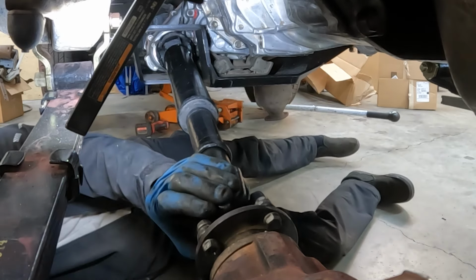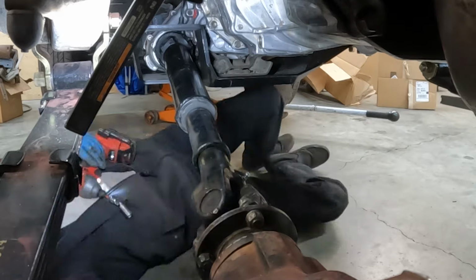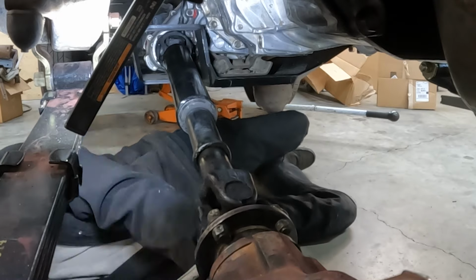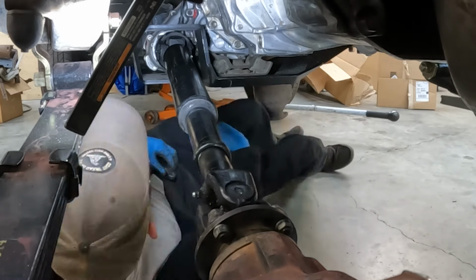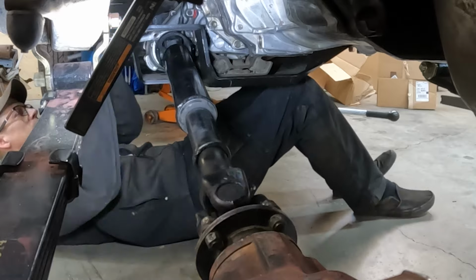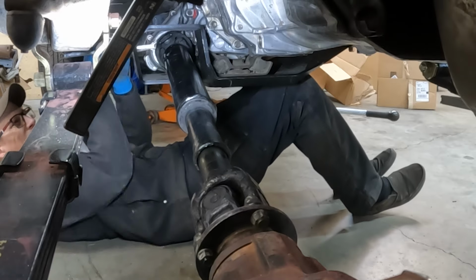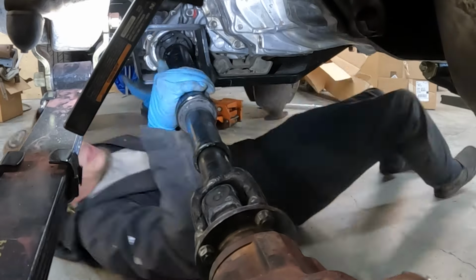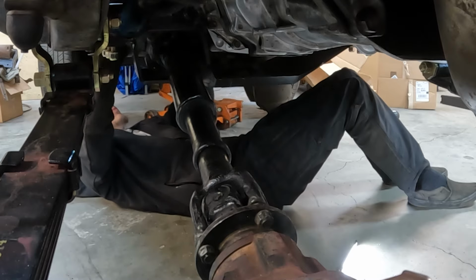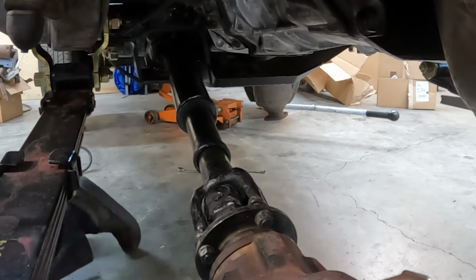This particular cross member actually ends up being quite a bit easier to deal with than the one built on the other truck. It makes that CV flange a little bit easier to access. So just another point for Sky's cross member here. Not much really to say here, just some basic driveline stuff. I make a habit of collecting those driveline bolts. Basically, they come with factory Loctite. If yours aren't Loctite, make sure that you Loctite them. And then a little bit of silicone in there makes sure that the flange will seal up. Some of the later flanges on the later transmission transfer cases actually use a second seal on the inside of that splined area. This early stuff doesn't, so make sure you put a little bit of silicone in there and make sure you stake that nut, and you should be good to go for plenty of years of trouble-free service.